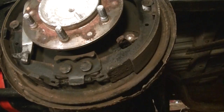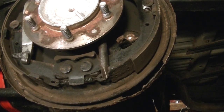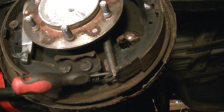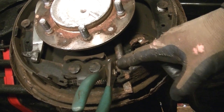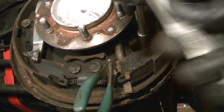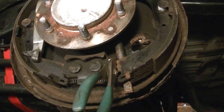The other one — you can't see it there, so I usually take a tire iron and put it behind the brake shoe and just push back like this to get access to it. You can take something and jam it in there to hold it so it doesn't come back. Or if you're really good, just take your socket and use one hand and get in there and take it out like this. I've got a pair of pliers holding that shoe back. This one will probably shear off also — yep, it's going to break. Twisted right off.